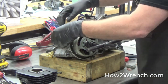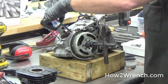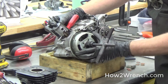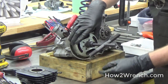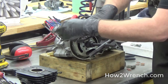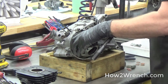A lot of times what the manual will have you do is take these bars and put them basically underneath here — there's a special tool for this — and when you rotate this down, that creates a wedge or a lock so it can't move anymore. But if you're smacking this with a hammer, that's putting a lot of stress on those aluminum piston skirts and the case. In my opinion, that's another bad way to do it.